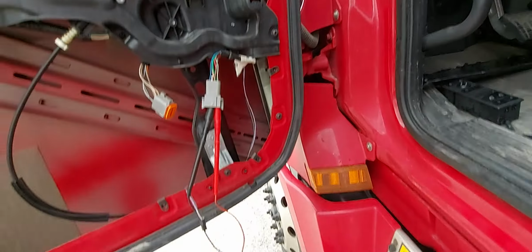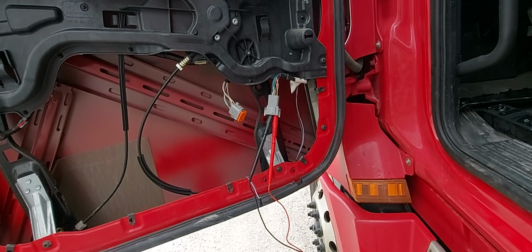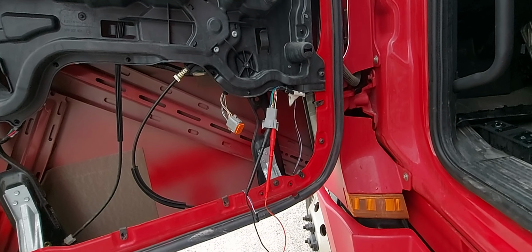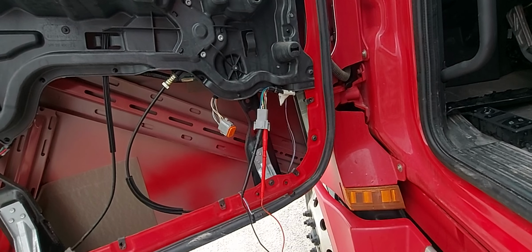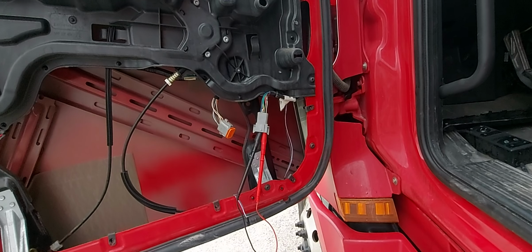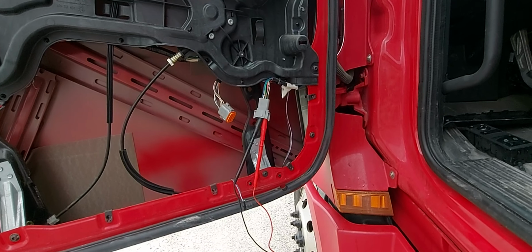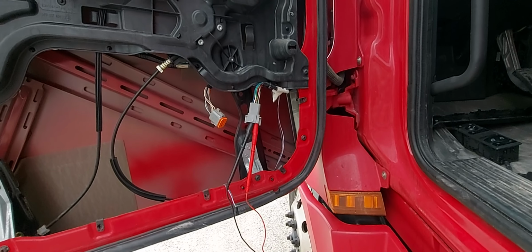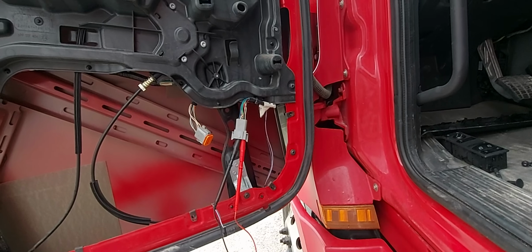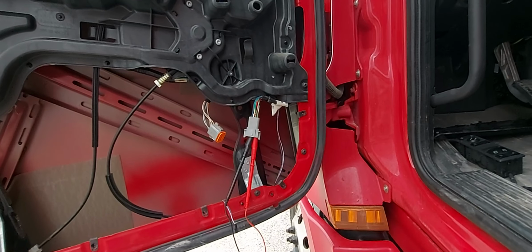My original intention was getting a potentiometer and hooking it up to those 2 wires so that I can manually adjust the temperature, and then put the potentiometer in the door somewhere so that I could always bypass the internal settings that the company has set up, where if the temperature is between 20 degrees and 72 to 73 degrees, it shuts the truck off after 5 minutes of idling.